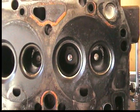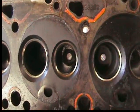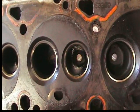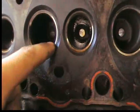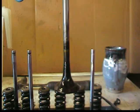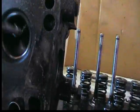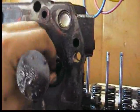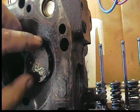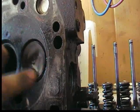If there is some slight differences between the valve and where it sits and seats, you'll want to go down to the auto parts store and get some lapping compound and stick it on the surfaces here and then on the valve. Then stick a drill on top of the stem and turn it while it's inside here like this, so that way it goes all the way up against the seat and then spin it — and it'll reseal it.